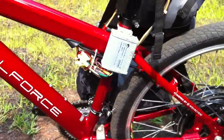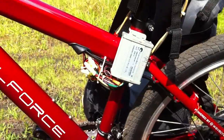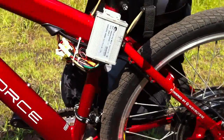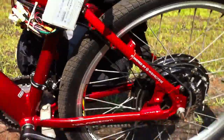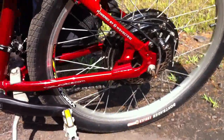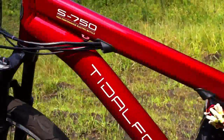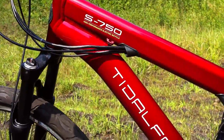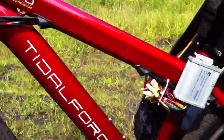So there's that little tiny 36-volt, 450-watt controller that I opened up in one of my other videos and upped the amps a little bit. Got the same motor. These frames are great — they have the top tube here that you can snake wires through, and it's got those little rubber boots to cover it, so I've got my throttle line going through there.